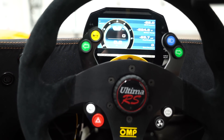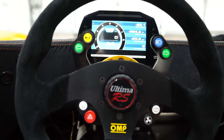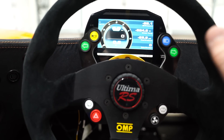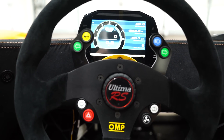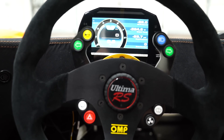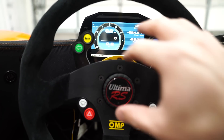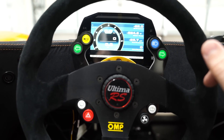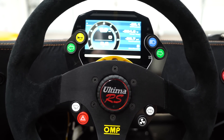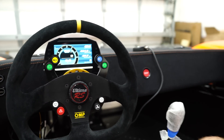This is the satellite number down there — the GPS unit right here. For some reason it says I have 0.2 miles on this thing even though it hasn't moved or even started — some sort of glitch, obviously. I've got the voltage from the battery, and you can do so many things with this. I thought it was just a digital dash showing RPM and speed, but this thing does tire temperature, tire pressure, ride height — anything. It's all expandable with tons of sensors and fully programmable for all kinds of different displays. There are shift lights above that I already programmed in 600 RPM increments all the way to redline. Really, really cool.